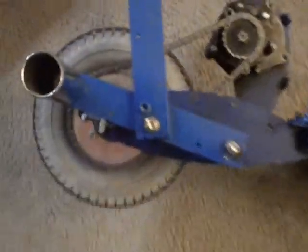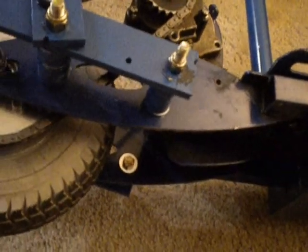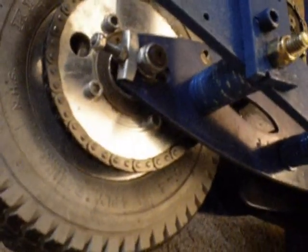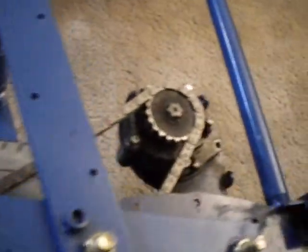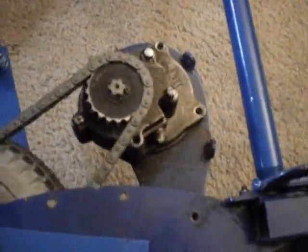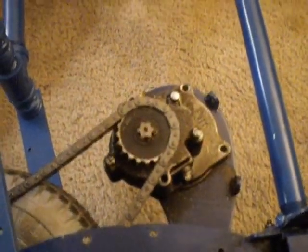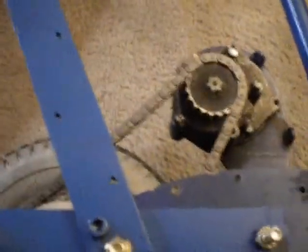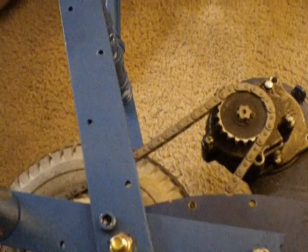I'll show you the metal. What I did was I just added washers to space everything out under there. I have the rear wheel just sitting in place — the chain isn't tensioned yet. Because you have to add the motor on, and that'll strengthen the gearbox bracket. Right now it's not rigid; you have to bolt the motor on, and there's a plate that goes on the frame here. That all bolts together, otherwise my chain won't be accurate with the tensioning of it.